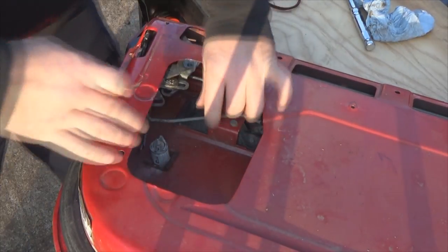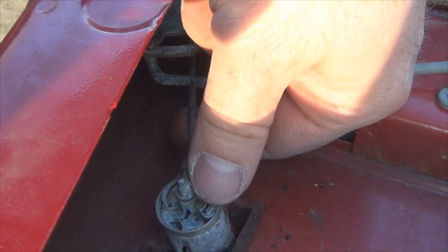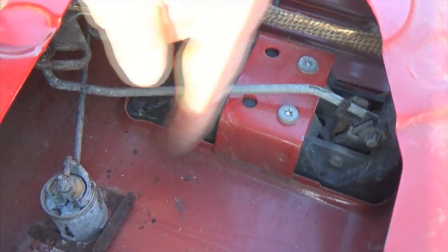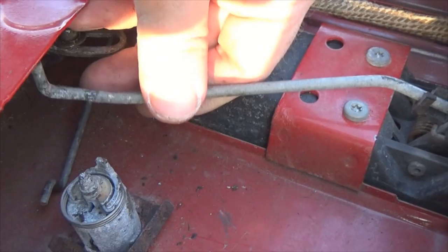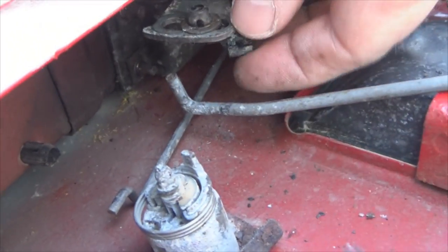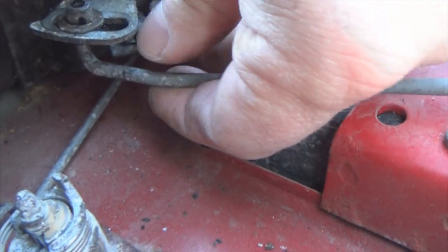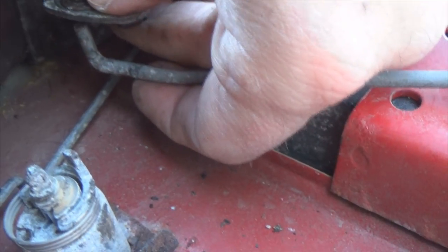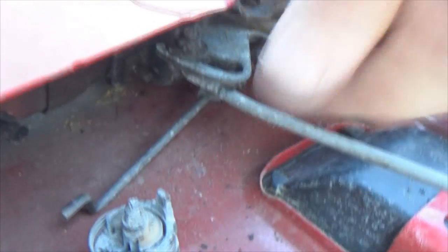Now your rods - put them back in place. This right here is the one that runs to the outside paddle that opens your door. It needs to go in first because this rod has to sit below that other one. It's very easy as you're removing these latches and moving stuff around for this to end up under the other rod, and you think that's the way it goes - then you try to put it back together and it won't go, and you're fussing and cussing trying to figure out why. Put this one in first, position your clip, and push it back or reach underneath and pull the handle to align that rod into the clip. It's a lot easier with two hands.